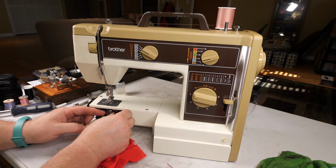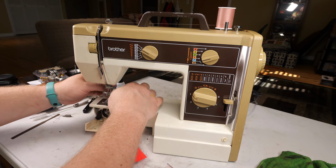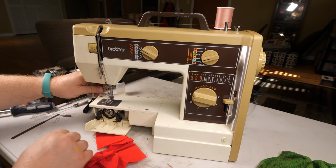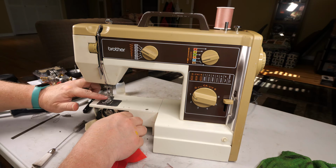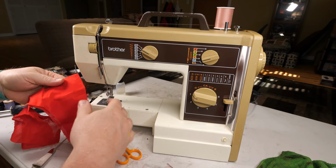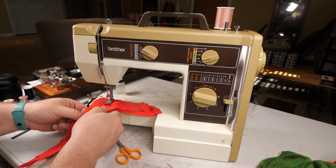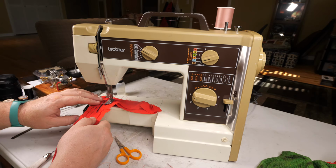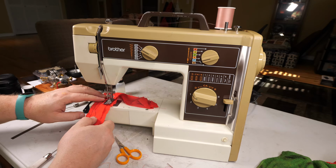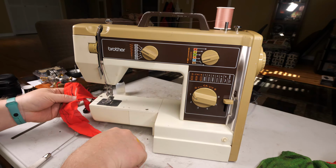I've got the upper tension set only at like 4.5. So for the zigzag at extra wide setting, we want it to be more even than that because we're at the lower end of the ideal upper tension setting. Okay. So, all right. Now with the bobbin tension up, machine set at 4.5.